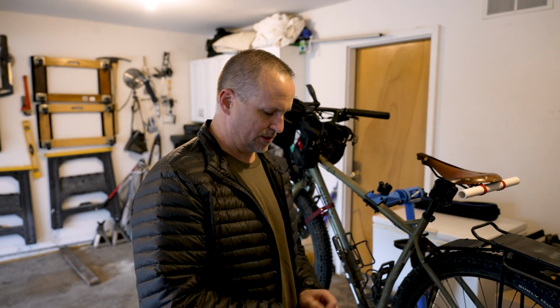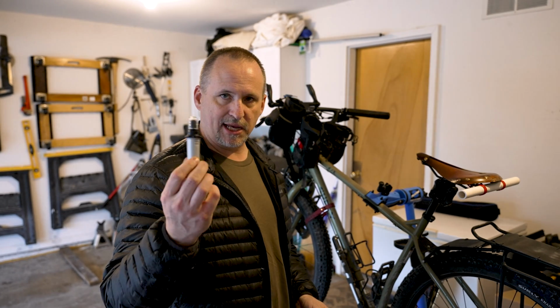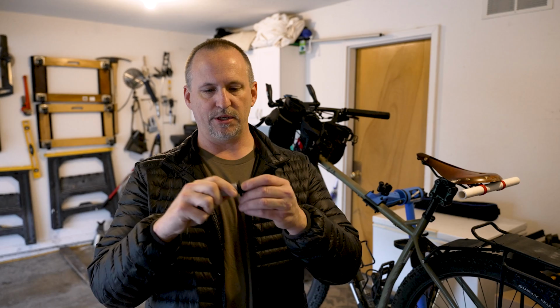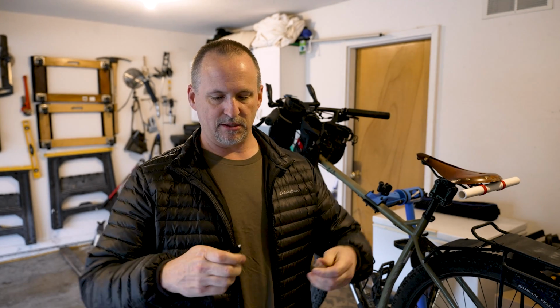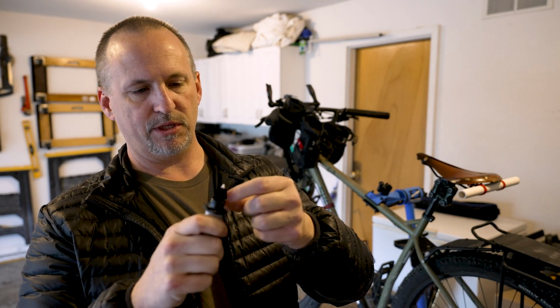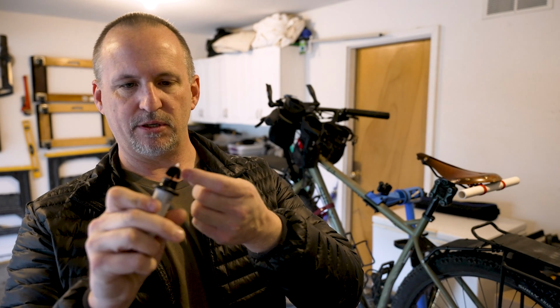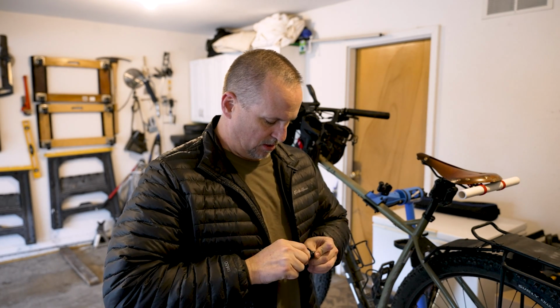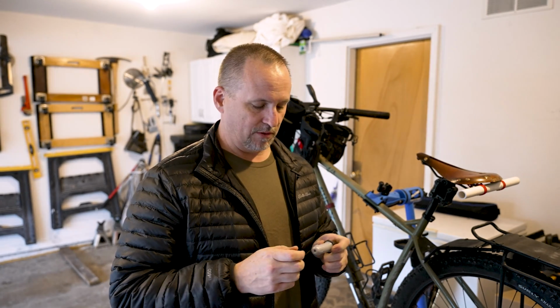It was losing air. The other thing I think you should consider is a Stan's Dart tool. If you haven't seen these, you should check them out. It's a little plastic device that has 2 darts, one on each end. And what it is, it's got a plastic tip with these little flaps on it that reacts with the sealant, seals up a hole. So you should be able to use those. You can sometimes use even multiples. And what you do is you put it in and you leave the plastic component in there and it just sticks in there and stays.